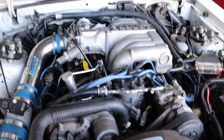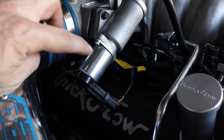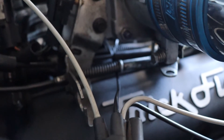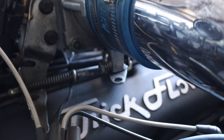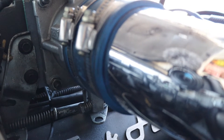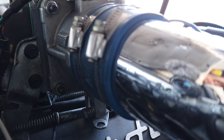It's pretty straightforward to do this, just like every car from this era. You do have to disconnect something, and it's going to be the idle air control module. Simply disconnect that connector, then come to the back side where your throttle cable goes underneath. This is going to be visually challenging, but you can see a screw down here — yours might be an Allen key; in my particular case it's an 11mm bolt. We're just going to turn that clockwise or counterclockwise to get to the desired idle. If it is idle surging, sometimes too low of an idle will cause that, so we're going to try to play around with that and get the base idle set.